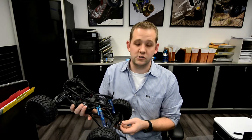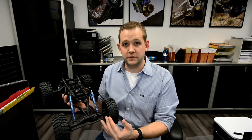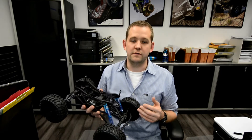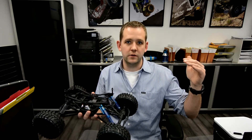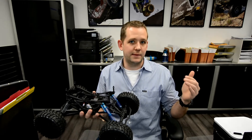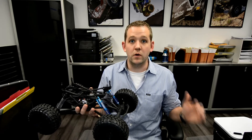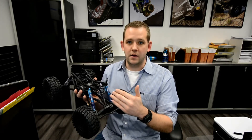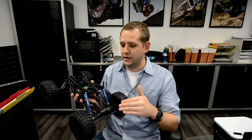If you haven't made your upper shock mounts yet, that's perfect. The more flexibility you have when you're giving us measurements, the better off you are. When doing a solid axle setup, you want your lower coilover mounts as far apart on the axle as you can put them, you want your upper shock mounts as high up as you can put them, and you want the tops leaning in at about 5 degrees — you kind of want to create a trapezoid shape with the tops leaning in at about 5 degrees. Also, the higher up your upper shock mounts are, the more stable the vehicle is going to be. I always use the analogy of a boat out in the ocean — the more weight you put on top of that boat, the more top-heavy it's going to be and it's going to tip over. Take that same amount of weight and put it into the hull under the waterline and you won't be able to tip it over no matter what you do. So the higher up your upper coilover mounts are and the more weight you get below that, the more everything is working in your favor.